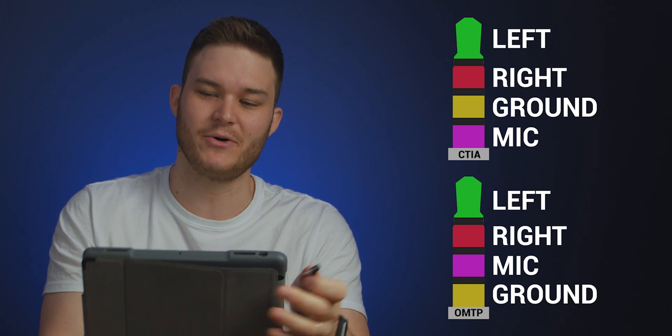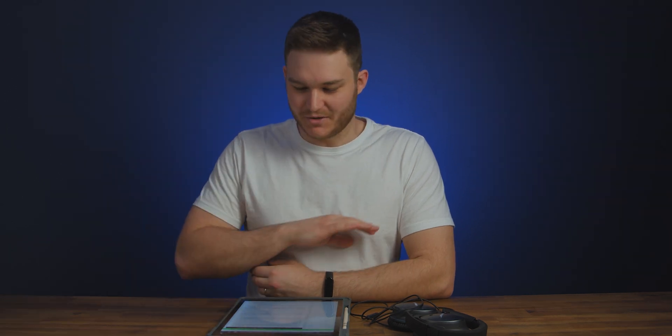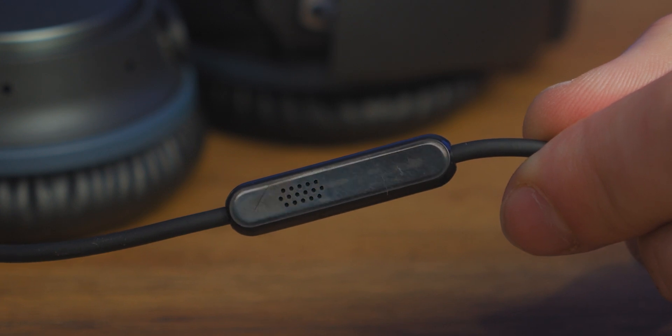What is exclusive to Apple is how the microphone and inline controls work. I've got a web page here — I'll link it in the description — it's the Android breakdown of the headset jack. Android is fully transparent; you don't even need a dev login to view this information. It breaks down what happens when you plug a headphone in and what the different tip, ring, sleeve inline controls actually do. There are a few functions: stereo audio out, microphone in if it's TRRS, and a grounding pin.